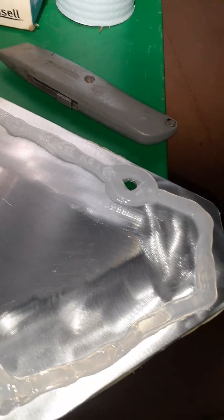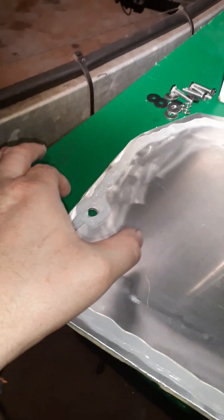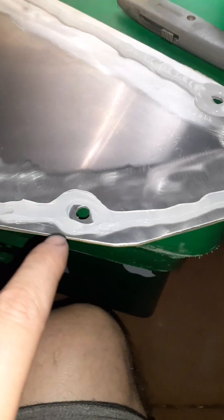You don't want to do too thick of a bead where it spreads over the whole flange, because when it comes time to getting it off it makes an absolute nightmare. If the silicone's spread that thick you'd have to bend the thing to get it off. So just a thin bead sealing all your edges and around the holes, and then add a bit of extra silicone to the nutserts.